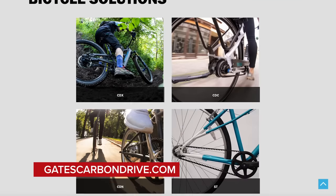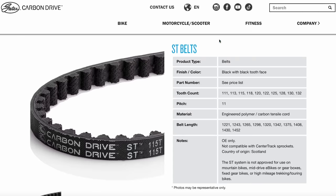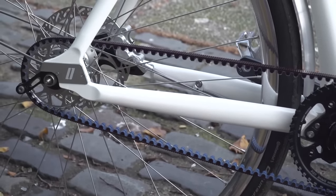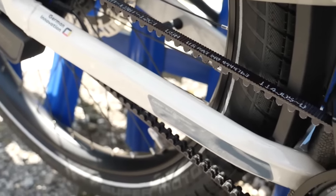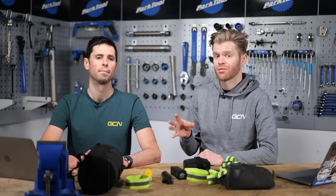If you're trying to win the Tour de France, this is the kind of thing that would keep you awake at night. If you're just looking to cruise around, have fun, and have incredible adventures, then belt drives are absolutely amazing. There are other disadvantages though — a belt drive is going to require a specific frame design, and typically you're only going to have one gearing option, so you'll need to run a single speed, or move on to internally geared hubs and gearbox systems. The range of gears from a belt drive is always going to be less than a traditional geared system because you don't have a front derailleur.